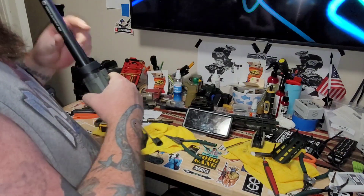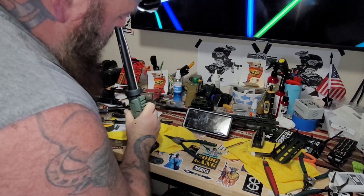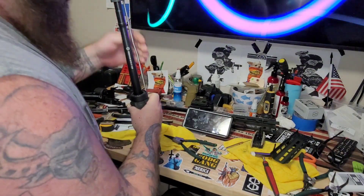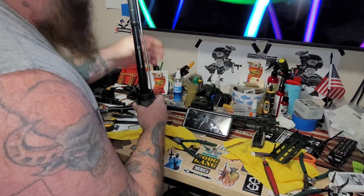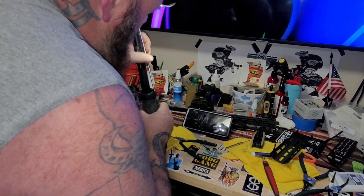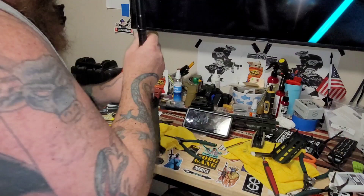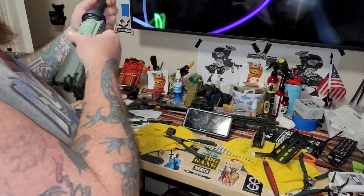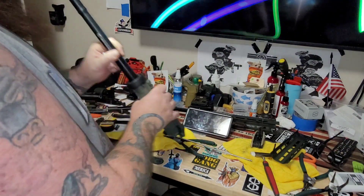Where's my dimple? That would go on this way, and that's got to fit into the groove without moving around — major pain. Don't forget this still has to be torqued; I'm just trying to mock it up. We're supposed to start with 30 foot-pounds and go up from there in five-to-ten pound increments until we're lined up properly.